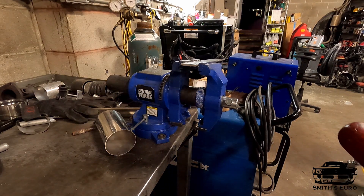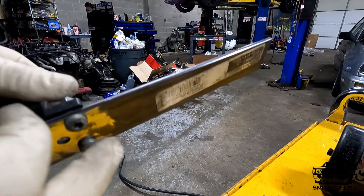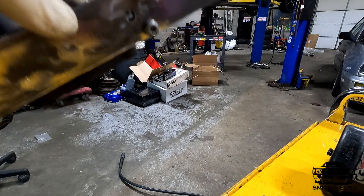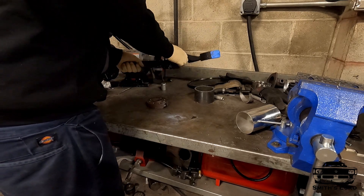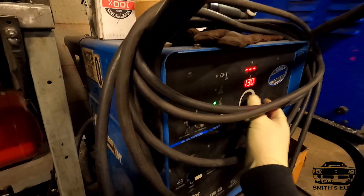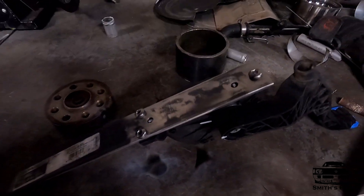Now that sits in flush — you can see the idea of it. I have three bolts through there and they're going to be welded on the back side to make them tight. Clean these off and then just do like three tacks — that's all you got to do is just tack weld these, it'll be perfectly fine. I'm going to be welding steel so switch it over to DC, and then it's pretty thick so I think 130 would be fine. And they're just going to be buzz, buzz, buzz — easy enough.